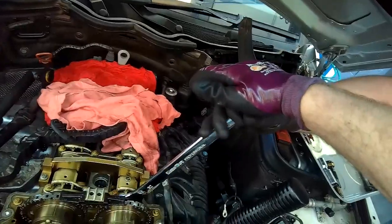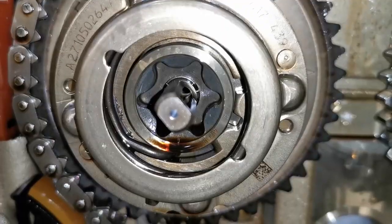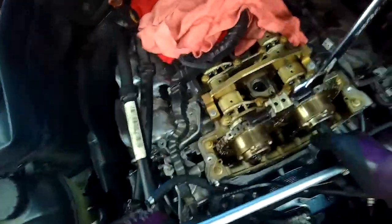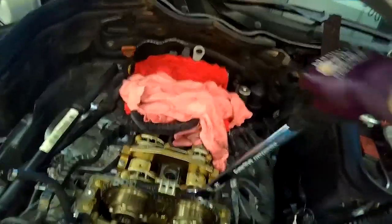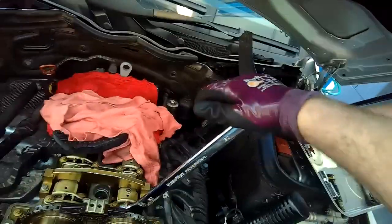To remove the camshaft adjusters you're going to need a special tool - the T100 torx - to remove the camshaft adjuster oil control valves, which is what's keeping those in place. I also highly recommend getting a slim 32mm head spanner to hold on the end of the cam to keep it nice and solid. I had a teammate hold that 32mm while I loosen the T100s.